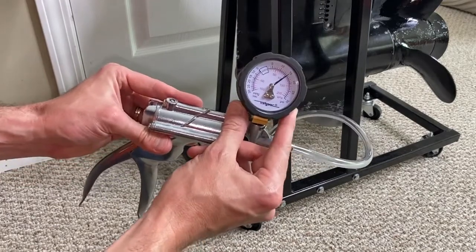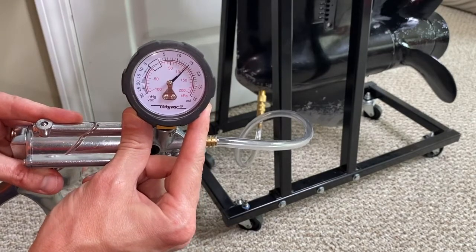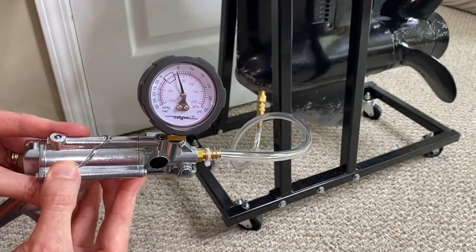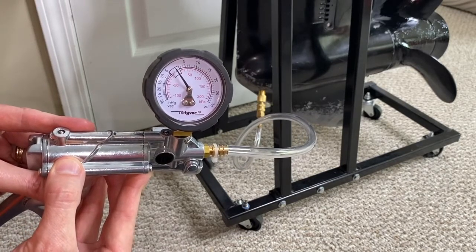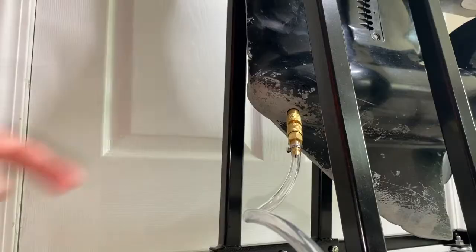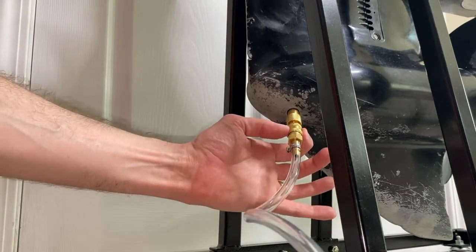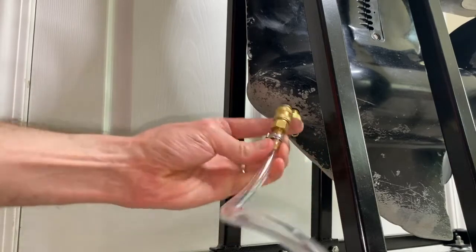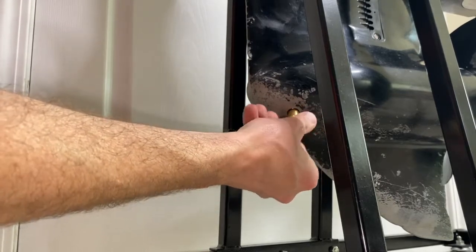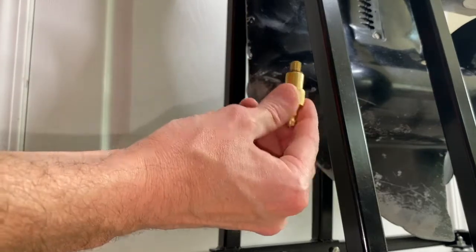Back to the outdrive — 15 PSI deadlocked on the gauge. Very happy and pleased with that. Now I'll carefully drain the pressure all the way to zero. Nothing else coming out. Moving to a closer view of the outdrive fitting that screws into the drain port — to disconnect the two fittings, carefully pull down on the upper connection shaft of the fitting. Very user friendly. Next, carefully remove the fitting — all we did was hand tighten it. Once you remove the fitting, ensure that the rubber O-ring is still placed on the fitting itself.